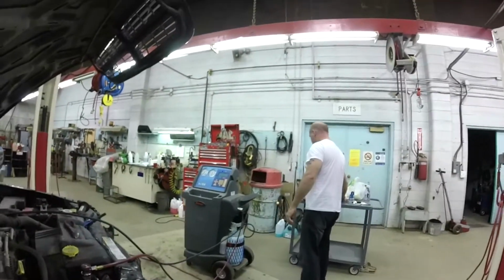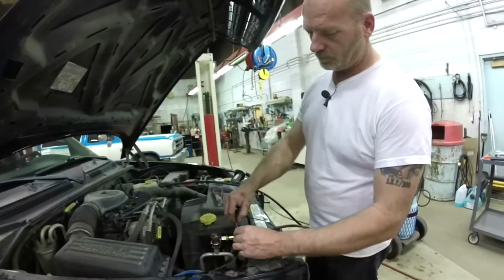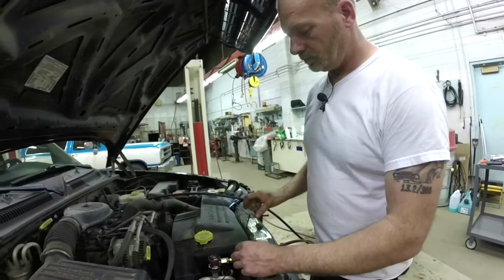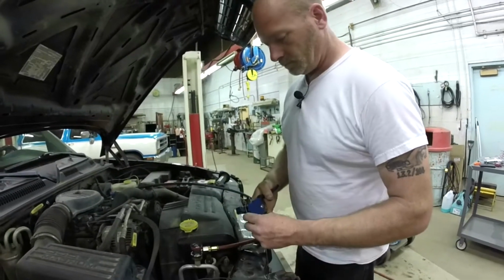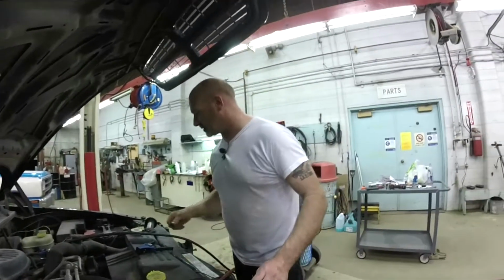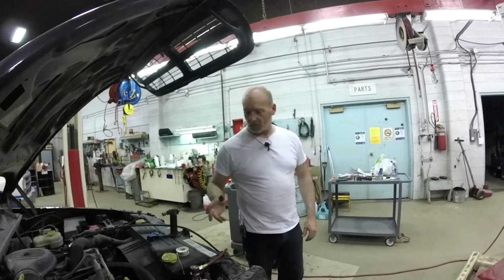Click. Solder and shrink tube, the only way to go. Now, I have heard that if you're doing some wiring right beside some very, very hot components, like turbos and exhaust, and you just can't get enough heat shielding on them, then there are times when you just use a little steel sleeve crimp and crimp it and shrink tube it.